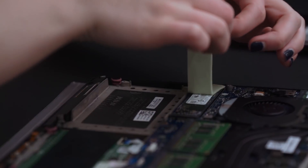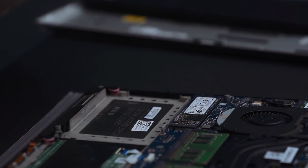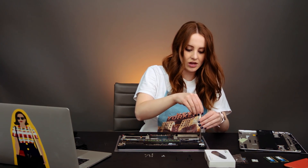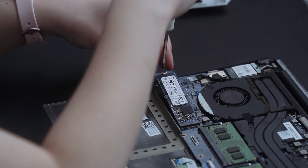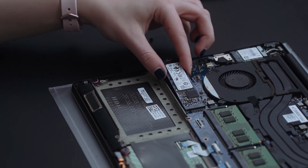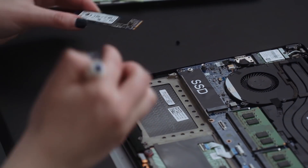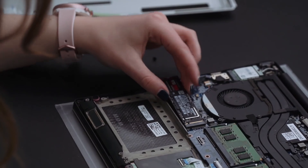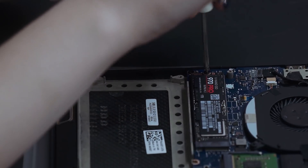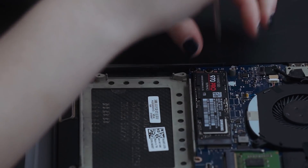We're going to start with the SSD. On the videos that I've watched, this thing usually stays on the shell, but we'll just make sure to put it over the SSD after. Unscrew the one screw that is holding down this sad little slow SSD. Put the screw right here and then you just pop it on out. I'm going to place the new one in at a slight angle here.